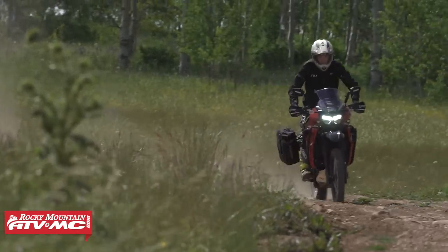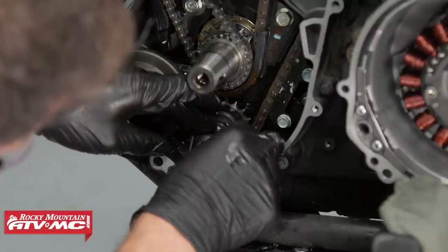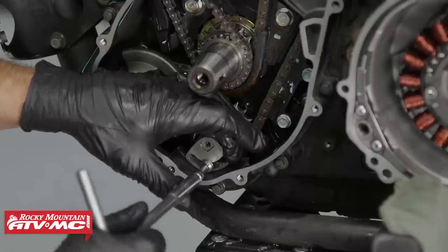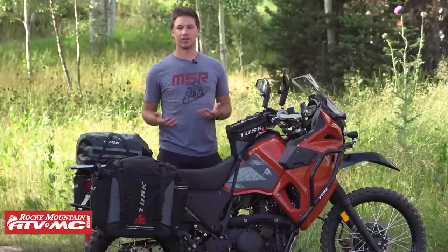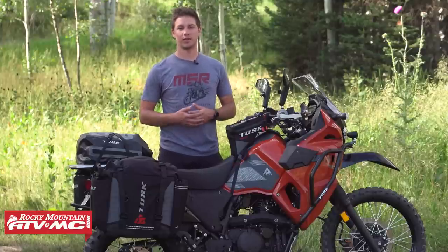The next category is the engine, and with the engine comes the infamous topic of the doohickey. As we talked about in the first impressions, they haven't upgraded the doohickey design for the newer KLRs, so there's still the Eagle Mike torsion spring upgrade available. Whether you think you need to do it or not is debatable, but for me the torsion spring design is pretty bulletproof and the logic behind it really makes sense. It's just one of those peace-of-mind things — upgrade it and you don't have to worry about it down the line.